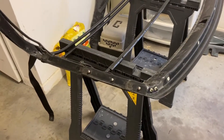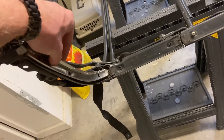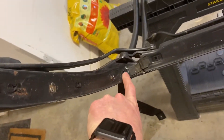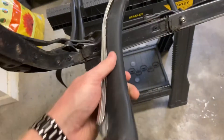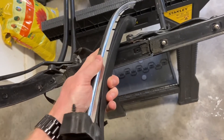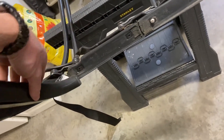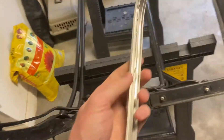As for around the windows and how those gaskets mount with the original soft top, you've got these little metal plates that kind of just bolt right up to the frame here and the gasket sticks to this metal frame. That just kind of sticks in there onto the gasket and bolts up to the frame. Basically what I'm going to do is mount this onto the hardtop like so.